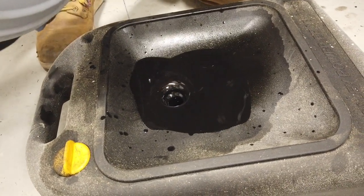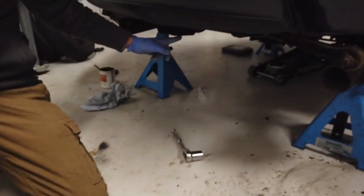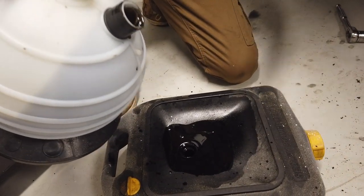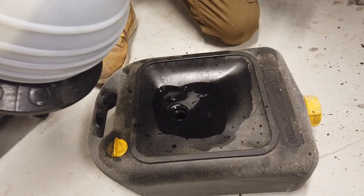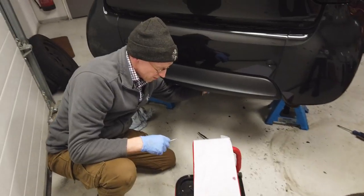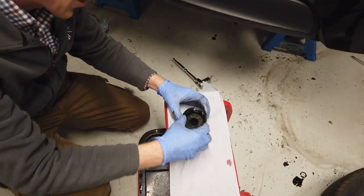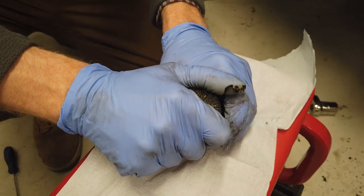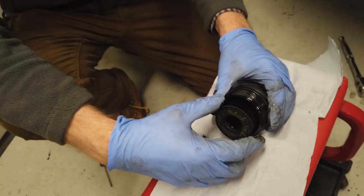As you can see, you do need to suck the rest of the oil out. You won't get it out even if you leave your oil filter open overnight — which I did — none of this came out. You need to use a suction tool to get it out. Let's go and grab the new filter. One tip: you should take your car for a bit of a spin before draining the oil to warm it up and thin it out.